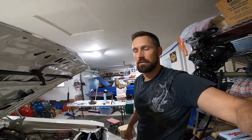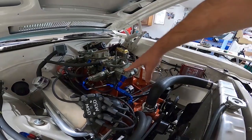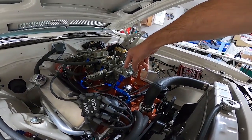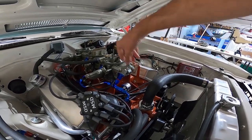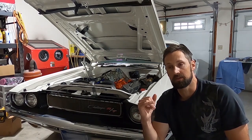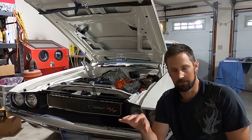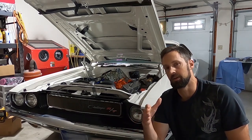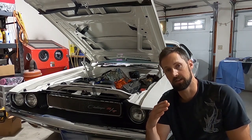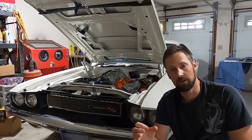What I found was that procedure didn't really work for me. I leaned out the front carb, translated that setting to the rear, and it was just way too lean and wouldn't run. All engines are different — maybe it would work for someone else. What I wound up with, for this engine at this altitude, was seven-eighths of a turn out — three-quarters was too lean and one turn was too rich. I had the outboard carbs at three-quarters of a turn and it was too lean. I fattened up the center carb to three turns out and it ran pretty good, but three turns out is a little excessive. So I fattened up the outboard carbs to seven-eighths of a turn and was then able to lean the center carb down to two turns.